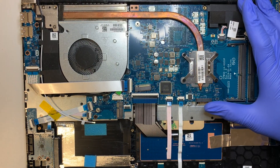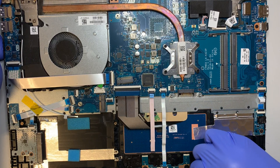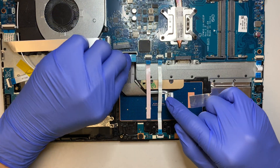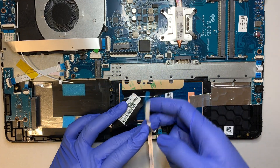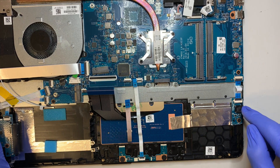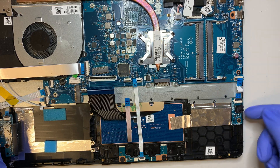You can see all the cables connected here. This is your keyboard cable, this is your touchpad, and this is probably the clicker on the touchpad for left click and right click. Let's go ahead and disconnect the keyboard, disconnect the touchpad and the clicker. This is the auxiliary jack - your audio speaker jack. If your headphone plug gets stuck in there, you can replace this port or try to remove the broken piece.